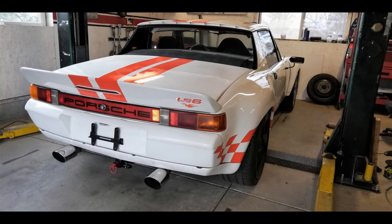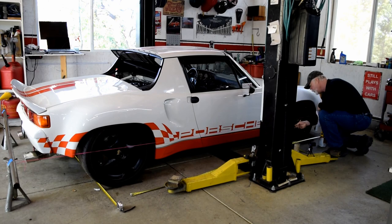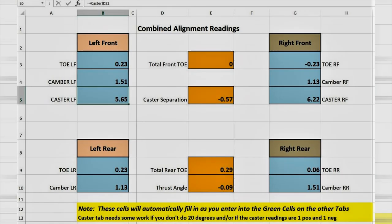Let's cover a couple of things on the work area. The car needs to be level. You can use a level to find the low spots and the high spots. If you're going to change parts, adjust ride height, and so on, do this before the alignment. Also make sure your tires are aired up properly. Since every car is different, I'll describe my process and try to throw in some general comments. I start by taking all the readings — I want to know what the camber, caster, toe, and thrust is for the front and the back before I make any changes.